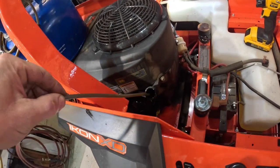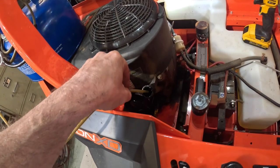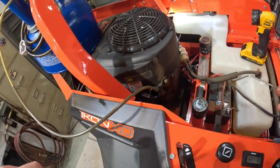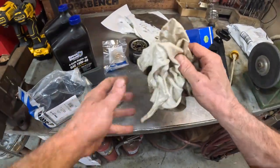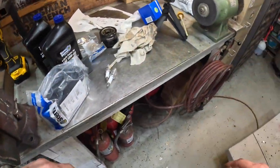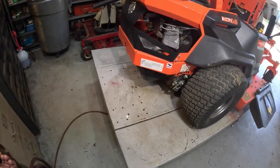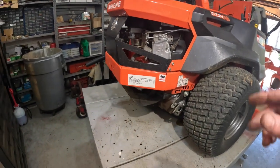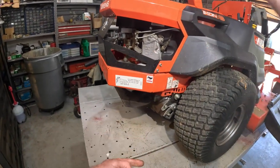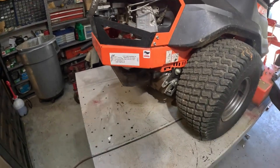This is still draining — see how you pull it up, you can see that suck of air. Wow, that is a lot of oil in that thing. I usually write the date on the oil filter with a paint pen, but you'll never see it down here. I like to just get it hand tight — that is plenty tight. Let me raise this thing a little bit so I can get to it.